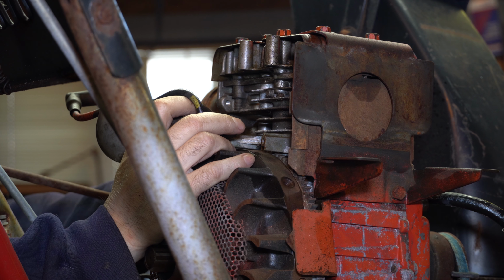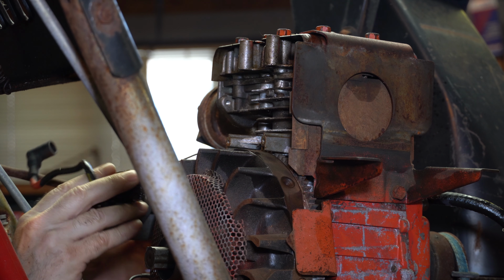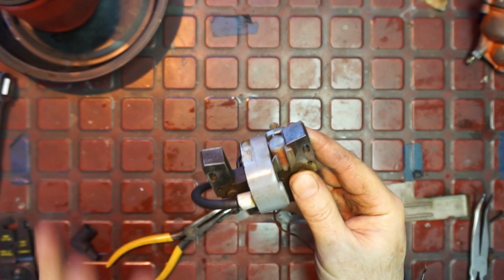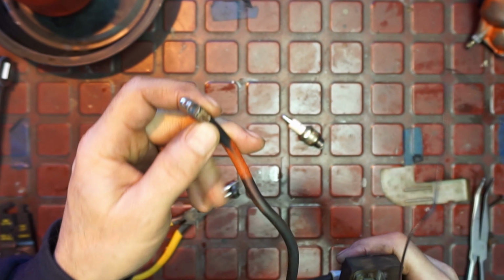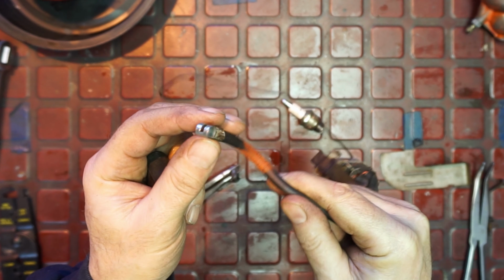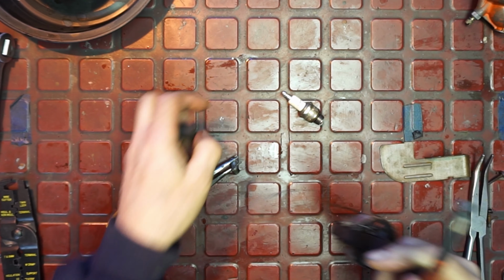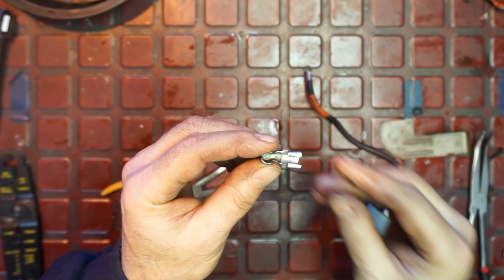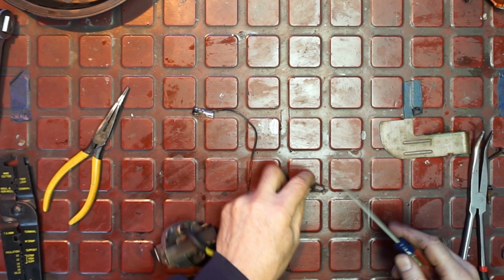This wire disconnects from over here where the electrical connection manifold is. Okay, so I cleaned up the coil, especially in the areas where the ground is going to be, and the same thing with the standoff on the block itself. I want to get that all clean. But the next thing I noticed is that when I pulled it out of its boot, it unfolded, and it's just like the old school style. So what you can also do, I'm going to hold on to that boot, is I removed a newer style, which has got this special spring steel clip on the end of it, from another coil. I always keep them from coils that are no good, or you can take it off of an older coil.